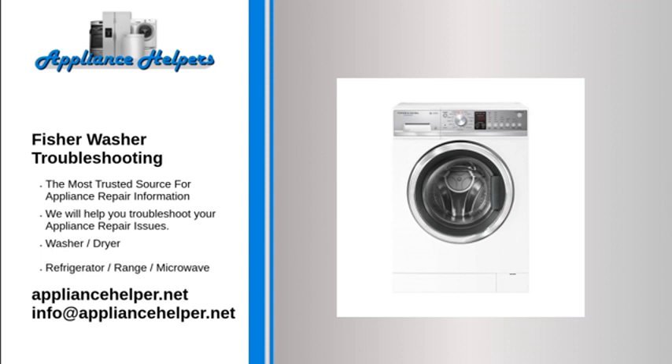The washing machine isn't draining. Check for blockages in the drainage hose — clear and try again. Check that the pump filter isn't blocked. Check that the drainage hose is not more than 1200mm above floor level — if it is too high, adjust and try again.